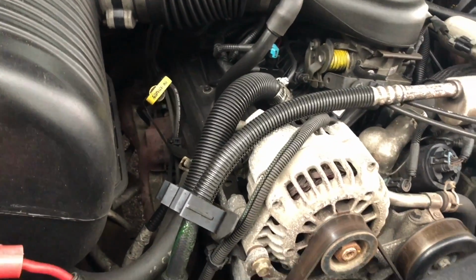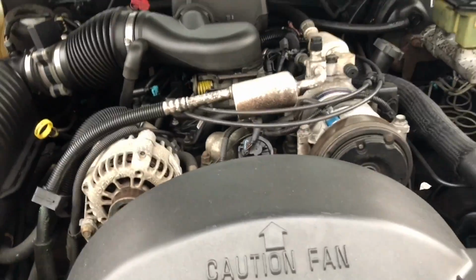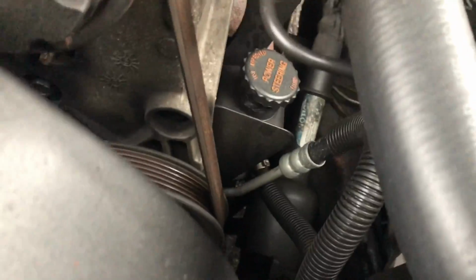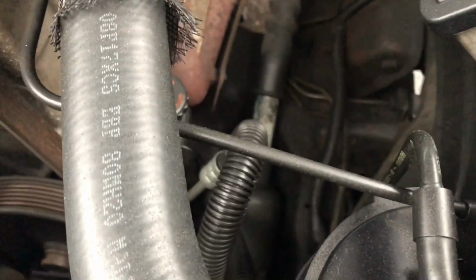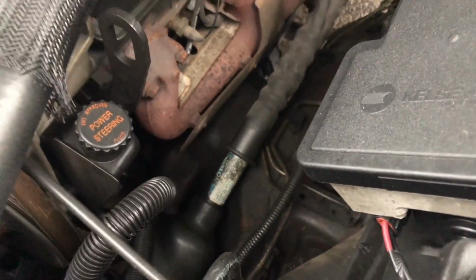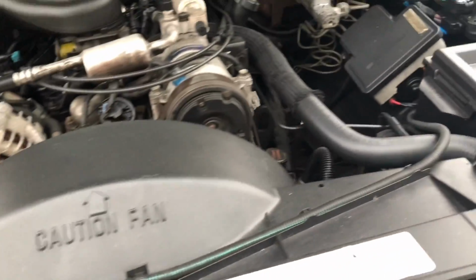So like I said, with the exhaust, it's getting new headers. See, yeah, possibly a Freon leak. Everything else working fine. Changed the water pump just because the motor is going to be out. Yeah, that power steering does look fresh. Y'all can see, well, the pressure hose is definitely new. You can tell by the way it feels, like if you've been driving for a while, or if you had this specific truck, because I had two of these. I know exactly what it feels like when the pressure hose is bad, because I had them blow multiple times. It looks like you got dual batteries over here, possibly. Oh, okay, this power wire is going to the inside of the car.